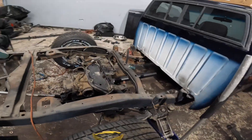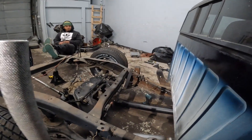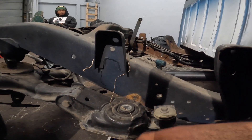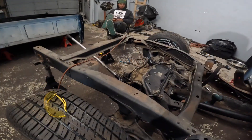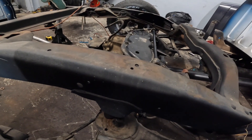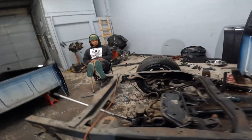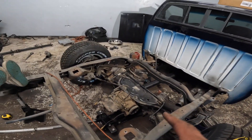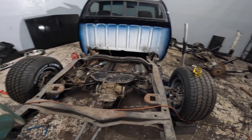This is what we got so far and I think it looks pretty good - it's going to work actually a lot easier than planned. Pretty much this is where the subframe mounts on the GTO. What we're going to do is run a block with a nut here - that would be the one mounting point on both sides. Then most likely cut off the bump stops here and build some sort of plate for the springs, or run a true coilover from the frame. This is almost identical spacing and measurement from the frame to the ground as my personal GTO. It looks like it's almost meant to be in here after some work.